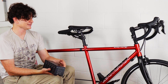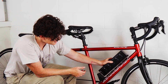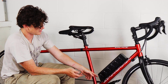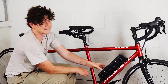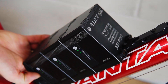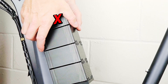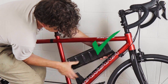With the rail cleanly and securely mounted to the bike frame tubing, you install the LIGO battery by dropping the assembled module in place just behind the connector and sliding it down. It will click into position, make contact with the docking station, and a small latch at the front of the rail will pop up to hold the battery from bouncing forward. When you want to remove the LIGO battery, you simply depress this lever at the front and then slide the whole assembly forwards — you don't remove the LIGO batteries individually one at a time; they come on and off the rail as an assembly of all the modules together.